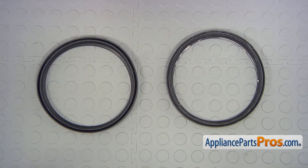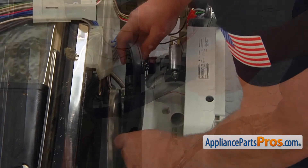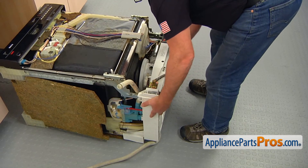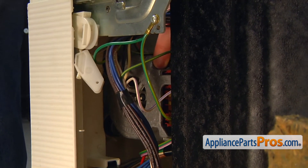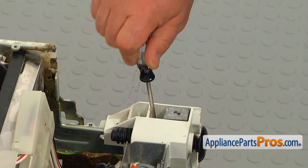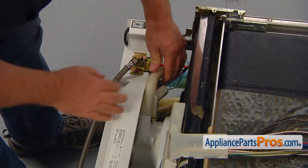This is the old sump gasket next to the new one. If you don't have this part, you can get it from AppliancePartsPros.com. Put some liquid soap on the gasket and install the new sump gasket. Push the base in so the sump gasket is mounted over the opening. Place the two motor supports into the openings in the base. Make sure the sump bottom support is properly seated on the rubber pad. Watch for the sump top and bottom and the two motor supports. Match the holes and install the two Torx 20 screws at the brackets. Insert the pressure chamber-to-sump hose and push it in as far as it will go, then tuck it under the retainer.